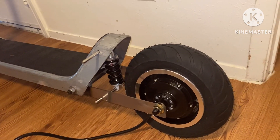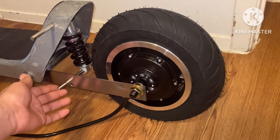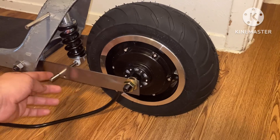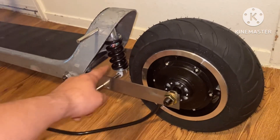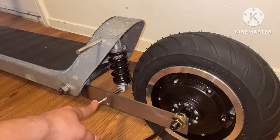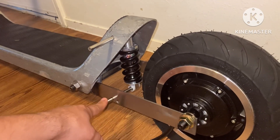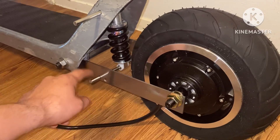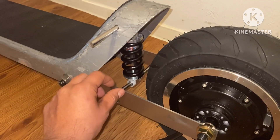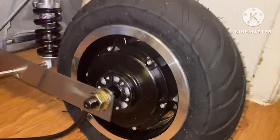It is working out pretty well so far. However, this rod is going to have to be swapped out with something thicker — that was something I already saw happening. I was expecting it to kind of bend, and that's what happened: it went down and it bent. So I'm going to replace this 8mm. It came as a 2-pack, so I used one for up top. Down here, I'm going to do something like a half inch — something this thick. I'm either going to weld that in place. It's still a prototype, still coming together — something to look forward to.